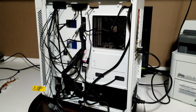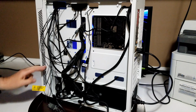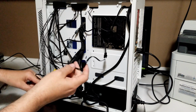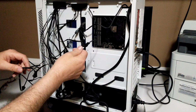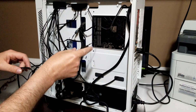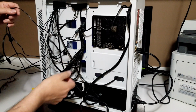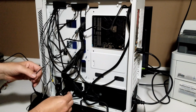Okay, so I've been playing around with cables for a bit. Basically, your cables are 3 fans from the RGB. Plug into the extension cable here. Yeah, I know it's a mess right now. Now, this plugs in to the RGB on the motherboard, and all your other fans just plug in wherever need be. One thing I did notice is the LED strip.